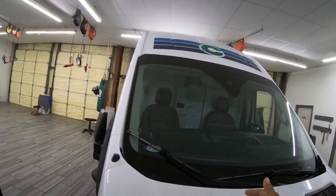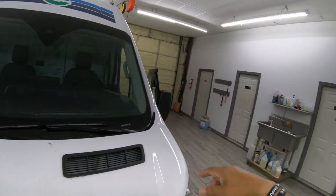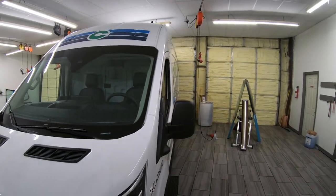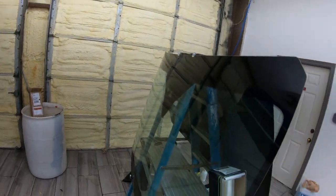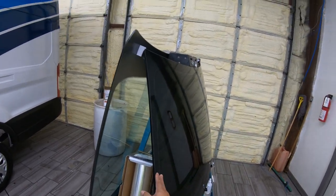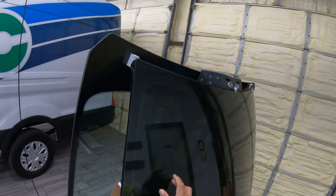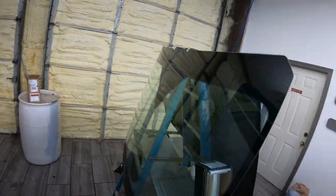I'm going to do one more tomorrow. I've already done a total of six of them, so a lot of experience. That's the reason I bought the windshield there to shrink it. I recommend that if you get into exterior windshield protection film application, you buy something that is either this big for fleet units or something a little bit more curvy. This is a Chevrolet 2021 or GMC 2021 Sierra windshield. For other sedans, I shrink here and then install over there — I just read the curve on both vehicles and they happen to be similar, so we use it and it turns out 100% correct.